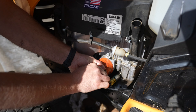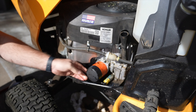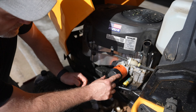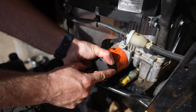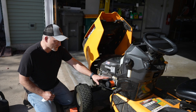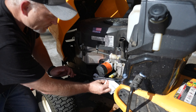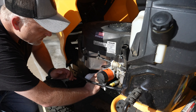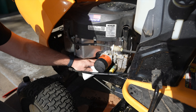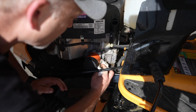When placing the new filter on, we'll just hand-tighten it so we don't over-tighten it — that should be good right there. The nice thing about the Fram oil filters is there are grooves on the end which make gripping it a lot easier. Now that we've got the oil filter installed, we can clean up the area. Just get a fresh paper towel and wipe this down really well — it's not totally necessary, but it will save some dirt from sticking and gumming up everything later on.